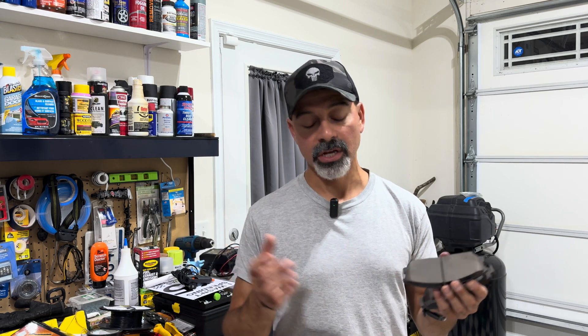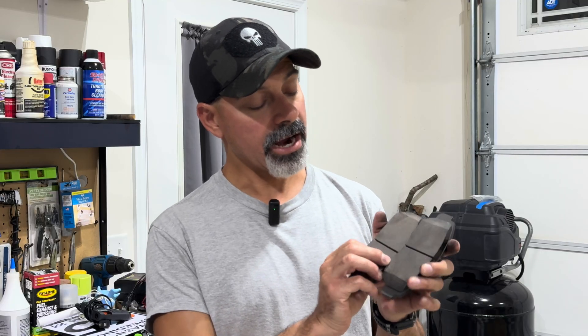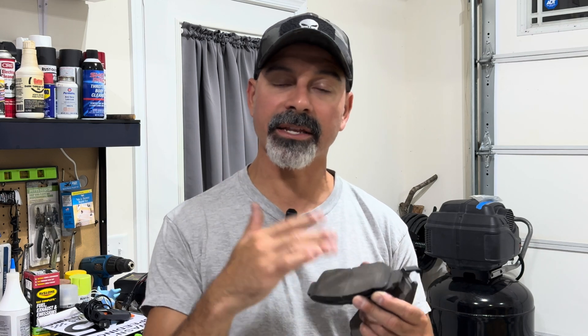Just wanted to go over this because I see people asking questions sometimes — what is that slot, what is that cut, why is it on an angle. They've seen ones that don't have any of that cut into it and they get concerned or they have questions. So just wanted to do a quick video explaining what they are, what they're called, what they're there for. To recap: the slot mainly is for friction, heat, and gas to be released through there. It's also a good wear indicator — you can see when you get below that point where you're down to the solid, it's definitely time to replace your brakes. That way you're not riding that little bit of skin still on there and then grinding and damaging your rotors.